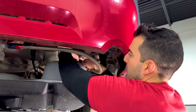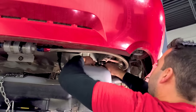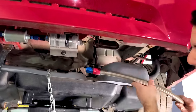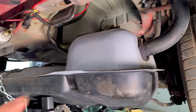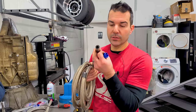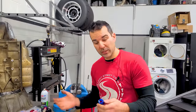This is just the feed to the pump, so very low pressure. They didn't actually put an AN line at the end of this — they just clamped it onto a barb fitting. There's the line coming off the pump. There are siphon tubes from this custom fuel sender that go all the way to the bottom of the tank, so the tank is higher than the fuel pump and it's able to get all the fuel from the bottom.